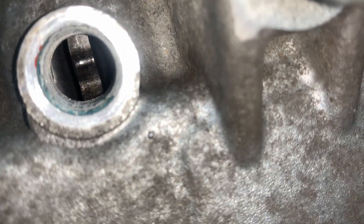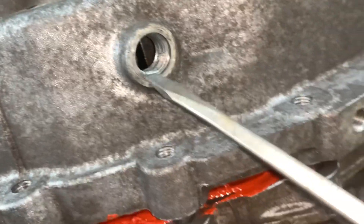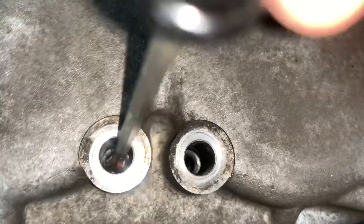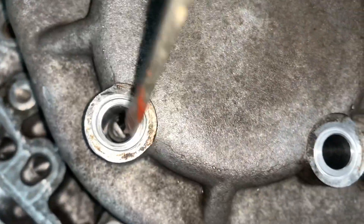You can see the groove is in there. Now I can put the bolt in — there it is, you heard that. Once you put one fork in and it's up, you can put the bolts in there. Have this flathead pushing up against the plastic or metal part, and when you get it right there you can put the bolt in — which is this one here. Once you're done you can start aligning the spools: you get a flathead, align that one, that one, that one, and that one right there.